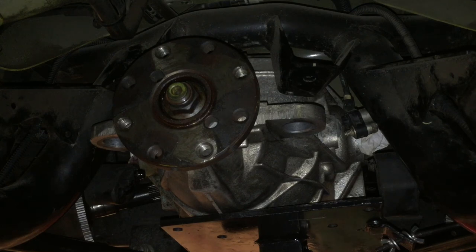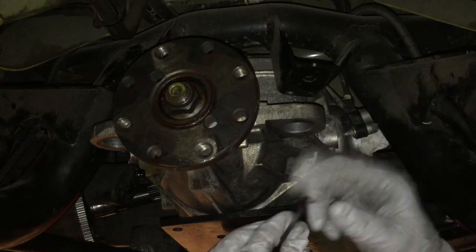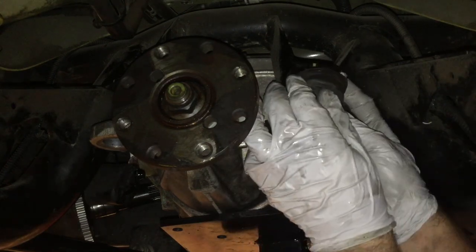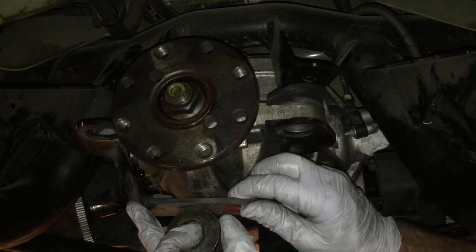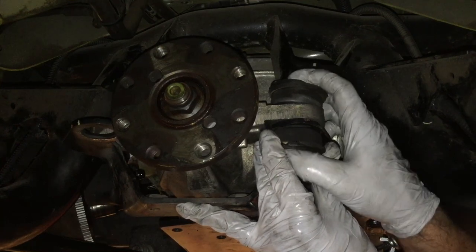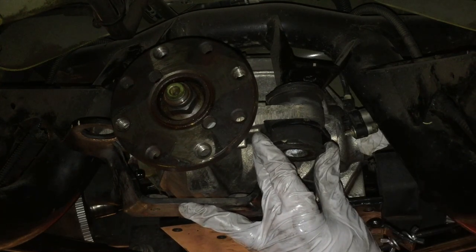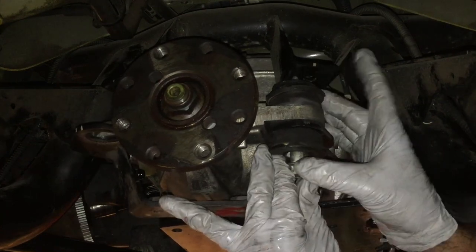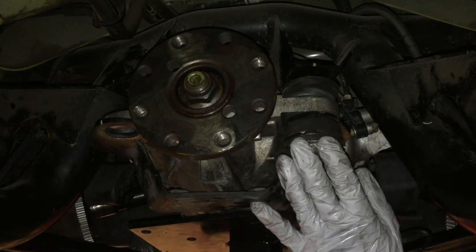To put this back together: take the top shim that goes on top closest to the top mount, then this bushing. These two go on the top like so. Then from the bottom you have the bracket that has the dampener, and that comes up through here. You want to find the markings on the front — we'll get to that in a minute. It goes up through and makes a nice little sandwich. Then we have the bottom bracket going through, but just one at a time we'll thread this through loosely.